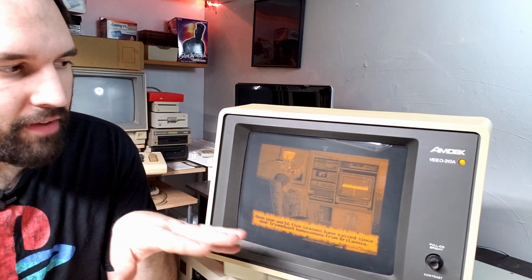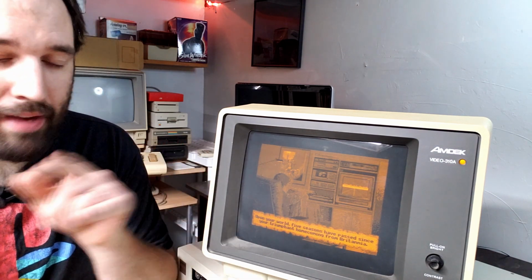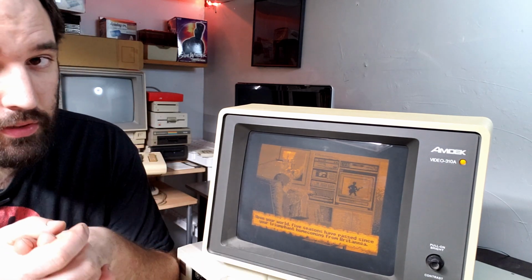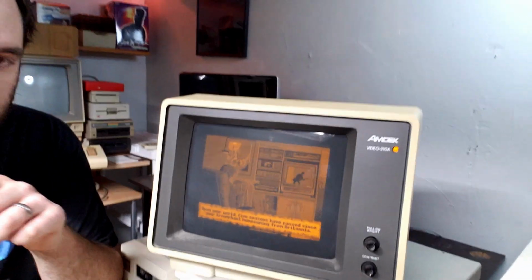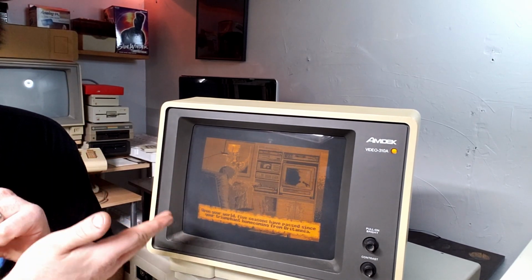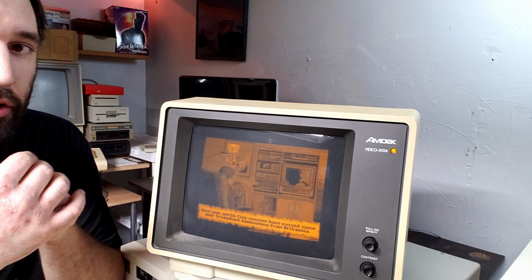Yeah, the sound card I have in here is a little staticky right now. I need to clean the audio ports. I put another sound card in here to test it, to make sure that the AdLib compatibility worked. But anyway, this is the neat thing about Hercules cards. It can produce single color, or 1-bit color, CGA graphics on a monochrome monitor.